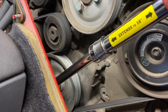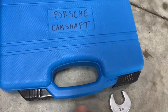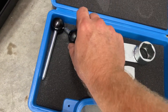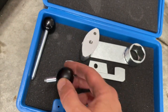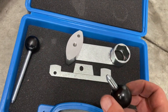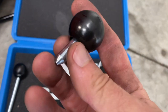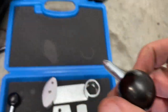I'm going to turn it a little bit more and get it close, then get out my cheapo Amazon Porsche camshaft tool kit. It has these pieces, and this one is supposed to be the right size to stick in there and lock it. It also comes with a longer one, but you're supposed to use the short one. If you don't have one of these, you can use a 5/16th inch drill bit, or possibly an 8 millimeter — there may be a metric size too — but that is the right size to stick in here.